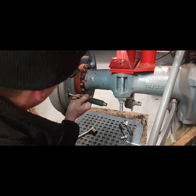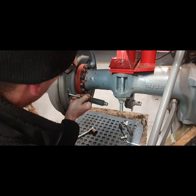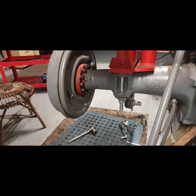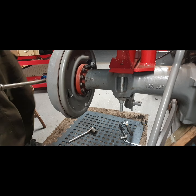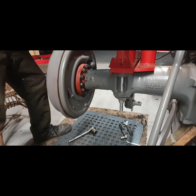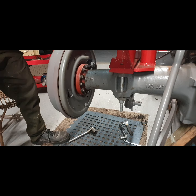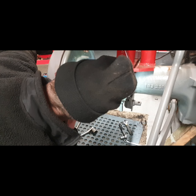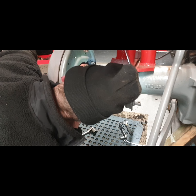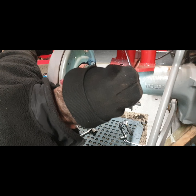You stand on the brakes a few times. Now, there can always be a little high spot here and there. That's getting hard to turn there. So I'll get my extension, put it on here and see what's happening. Hopefully feel a bit of resistance. Yeah, so there is definitely tight and loose spots in it. Fairly normal now, so it is. Of course, I was going the wrong way there.